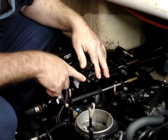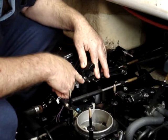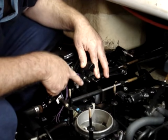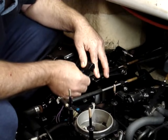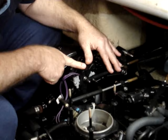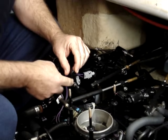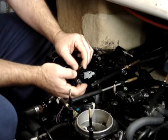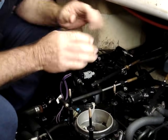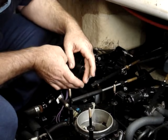The rear anchor pin for the lower shift cable is on a slot. We start with the pin in the lowest position on the slot. We can loosen that pin with a 7/16ths spanner down to the bottom. When we're in forward gear, that slot is vertical, so moving the pin will make no difference to the position of the cable or shift lever in forward gear. Once we get to reverse, the slot's at an angle, so moving that pin will actually increase the amount of travel on the lower shift cable. So if we have a problem selecting reverse gear, or if there's a bit of wear in the control cables, we can increase the amount of travel just with the movement of the pin on the slot.